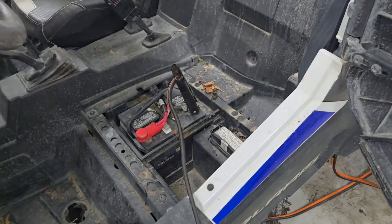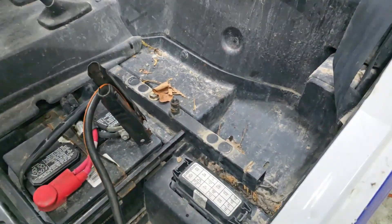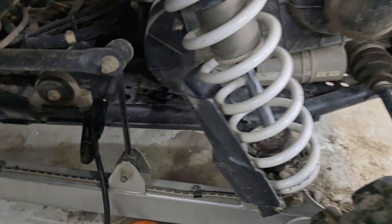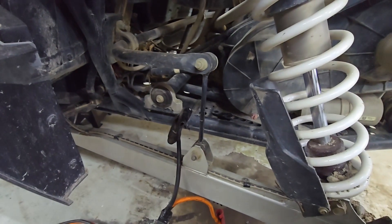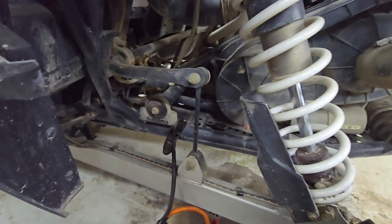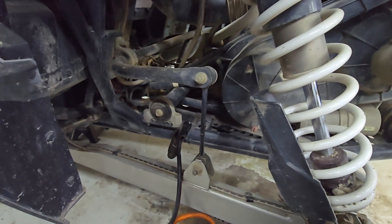Here's a simple demo of what I mean. Black to negative - I'd be putting both on, but just keep it simple, one line at a time. Something simple would be going right to the chassis here and then trying to restart it or seeing if the symptoms or codes disappeared. If they did, you just did the simplest check possible to eliminate so much on the diagnostic. This is my number one go-to - it's so simple, so quick. More technicians and tradesmen in general need to get into this habit.